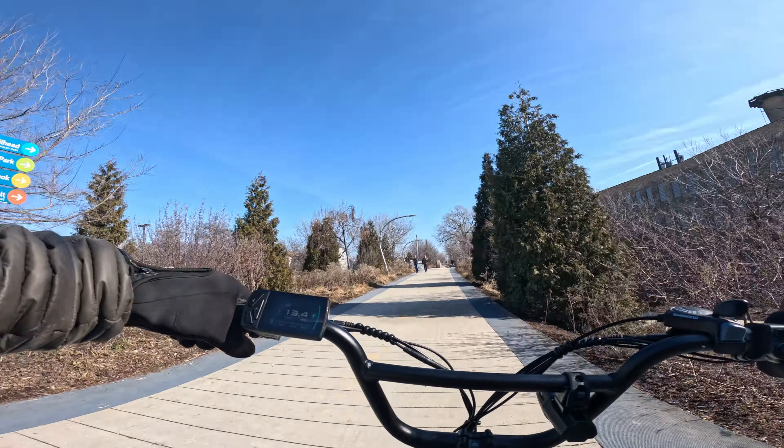To get the bike up to speed, I have both batteries going in all-wheel drive and attempt to reach about 30 miles per hour before slamming on the brakes. First run: right at 40 feet from about 29 miles per hour. Second run: 42 feet from 30 miles per hour. That seems like a lot, but this is a heavy bike. During braking, the bike didn't kick left or right, the tires gripped well, and everything felt in control. I feel good about the braking on this bike.